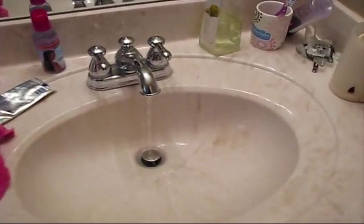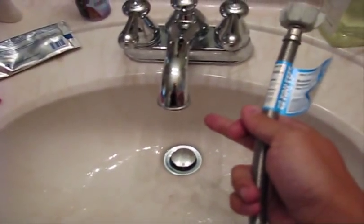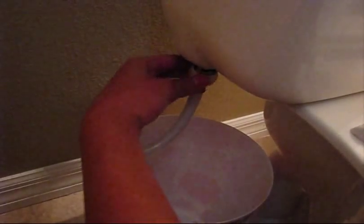Wait for it to fully drain — approximately 2 to 3 minutes. All water is gone, just a few droplets remaining, so the pressure inside the liquid line is released. Right now we have to disconnect this from the reservoir — it's located right there. You can use your hands, and if it's too tight you need to use pliers. We are twisting it off. Position a bucket so any water still remaining in the reservoir can drain.